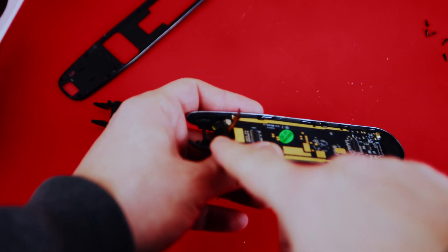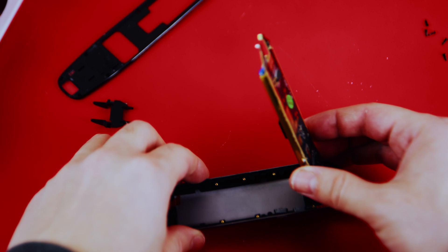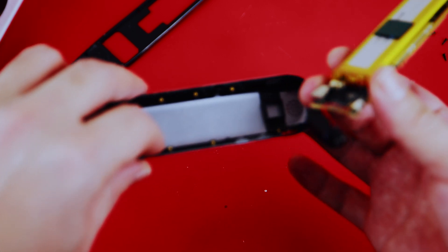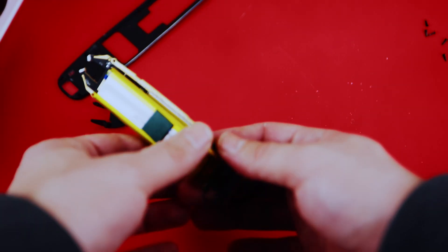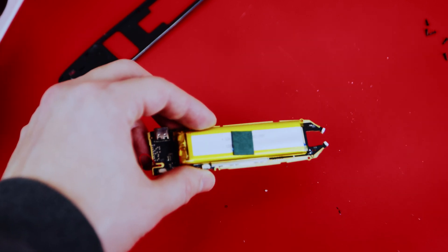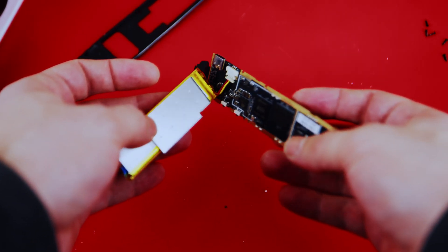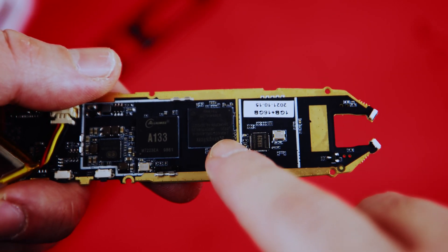You can see the camera connectors and this part can easily be removed. I can't remove the camera itself — it's probably glued. They even put some pogo pins here, probably for FCC regulations to prevent unwanted signal emissions. On the back side there's a large lithium-ion battery. Removing the battery is straightforward — the shield pops up with the battery, which is a nice design touch.